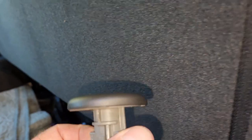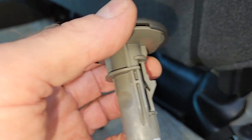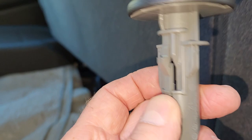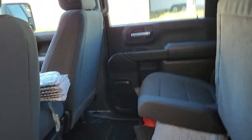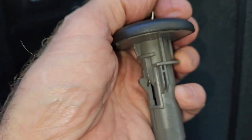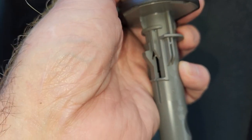There are four of those bolts — see that bolt right there — that way you can pull the seat forward, but first you've got to take the headrests out. You push this in and pull them out. See that little slot right there — this thing's in there like that. What you do is take a little screwdriver, go into that little slot right there, and then you pull toward you — it doesn't take much.